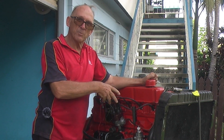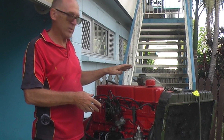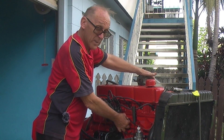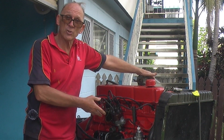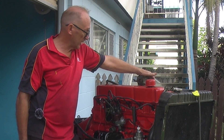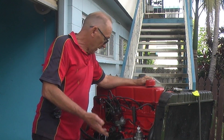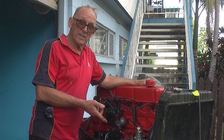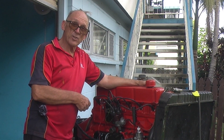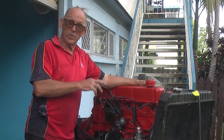This is the bad case being an XU1 with a vacuum unit — generally it's not a good combination with one barrel Stromberg sitting on it because it's already got vacuum at the port. I have to take this vacuum hose off to set the initial timing because it's already got vacuum at the port. That's because the butterflies are open too much. All distributors are the same — some are easier than others. This one was really, really easy.